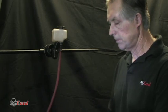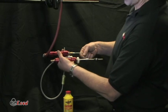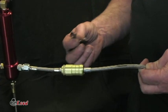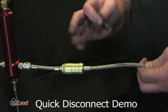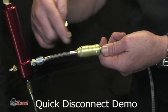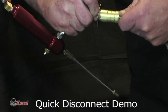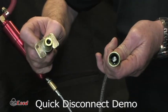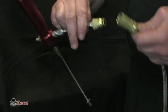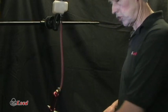You can always test this: if the bubbles are out, when you pull on the master cylinder, you can see that the rod of the slave cylinder moves — that means we've got all the air out of the system. Now I'm going to show you how to disconnect this line without losing any fluid. We have a little tool that goes right behind this little plastic sleeve. Slide that in there, push the line together, push on that sleeve, and it pops right apart — no fluid loss at all. Later on, when you want to put it back together, you just snap it together and you're done. So now that we're all bled, we're going to show you how to go ahead and install it.